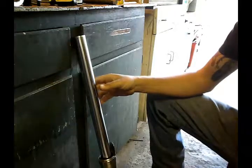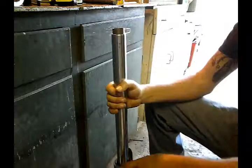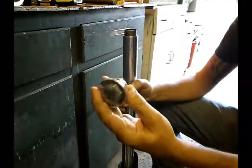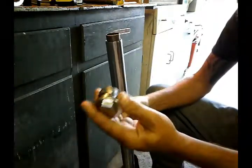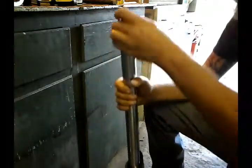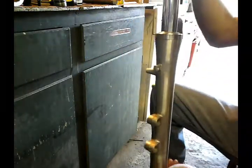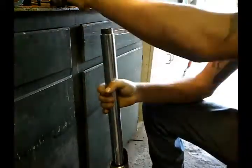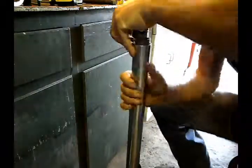The next I gotta find my spacer. Goes back in. And I'm gonna put again temporary this top rail, because on this motorcycle you have to put it in the bike first, and after it's already in the bike you put this top rail on. I still got the other fork to do, but basically we are done over here. The fork tube is replaced, it's got a new seal on it, and that's it. So second one's gonna be the same thing, so I'm not gonna show it again.